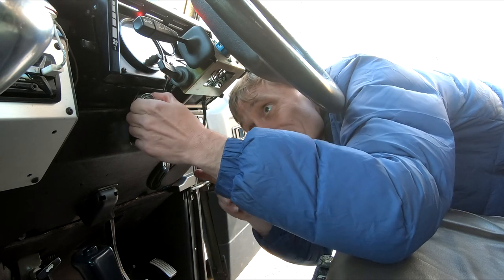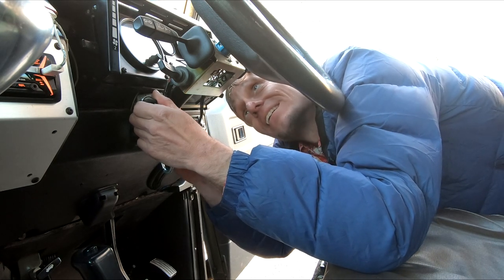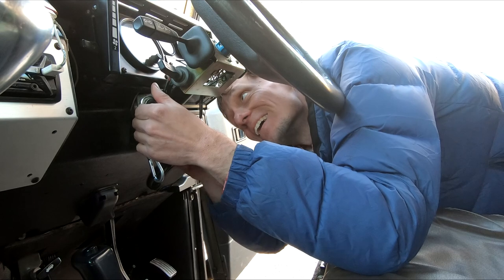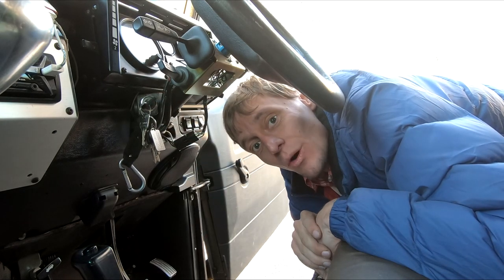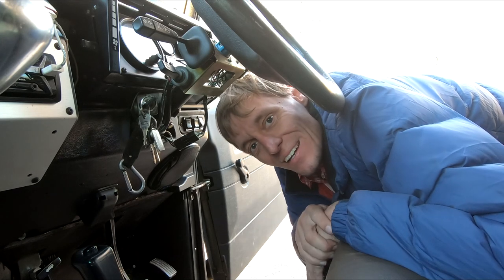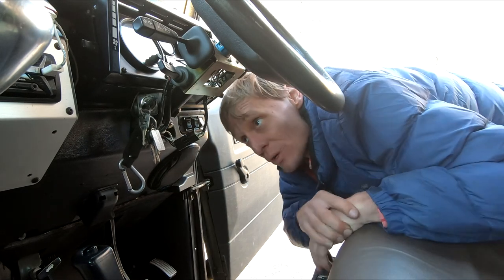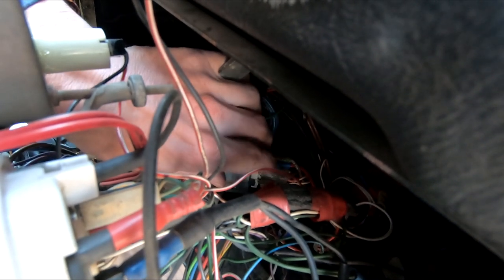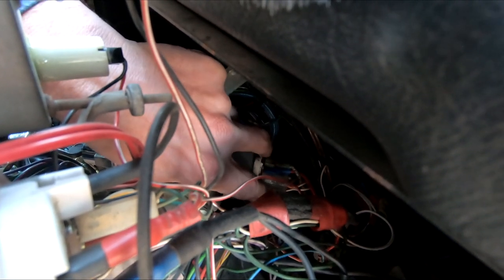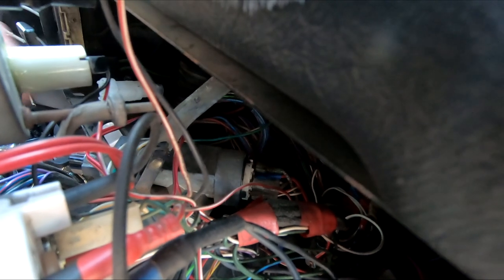You can see right here — I turn it like this and just push my finger back on it and it disconnects. So it's just loose on the back. It hasn't disconnected completely — it's still connected — but I've got glue on board so I might just need to pull it off, get some Araldite on it, really glue it down hard and maybe put some extra duct tape around it. That should secure it. It's still repairable, thankfully. You can see it moving here at the back — that's what's causing the ignition to shut off. The glue around here has failed, and that extra couple of millimetres of play causes the ignition key not to lock in and hold its place.